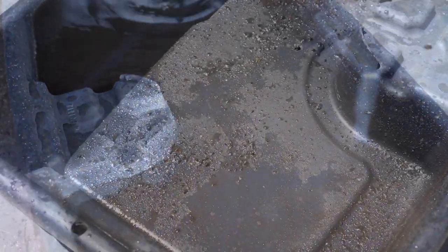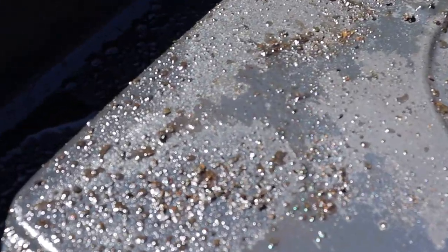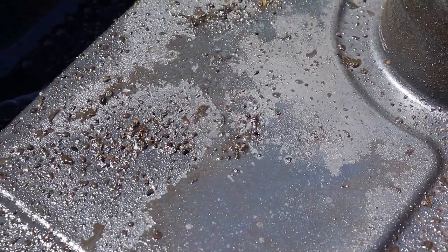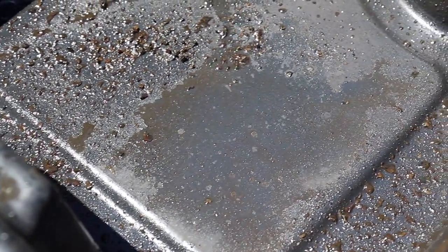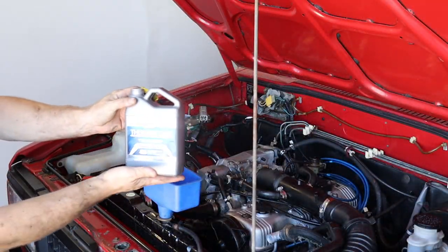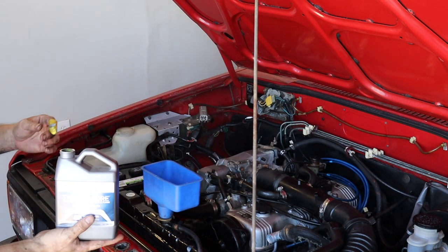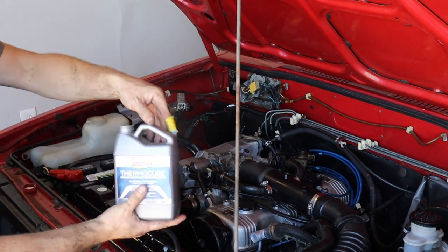A little bit of nasty material down that radiator. I wanted to show you this in case you're wondering if it's head gasket or oil or whatnot — clearly we have tons of rust particles inside our coolant getting flushed out. It's not good. At this point it's hard to say: do we swap the radiator out, or do we continue flushing? I'm going to keep flushing and hope this is just old material, and that our rust inhibitor and flushes will get that radiator clear enough. You can see these little chunks of rust — that's how you know. We're going to add our bottle of ThermoCure now, put the rest in distilled water, run that for about a week or so, then drain it, do a few flushes, and fill it up with regular coolant.